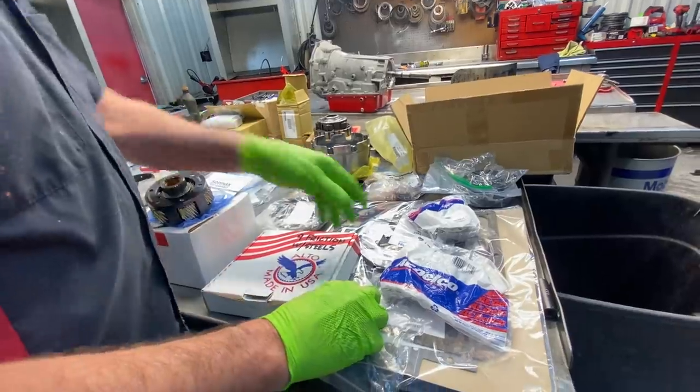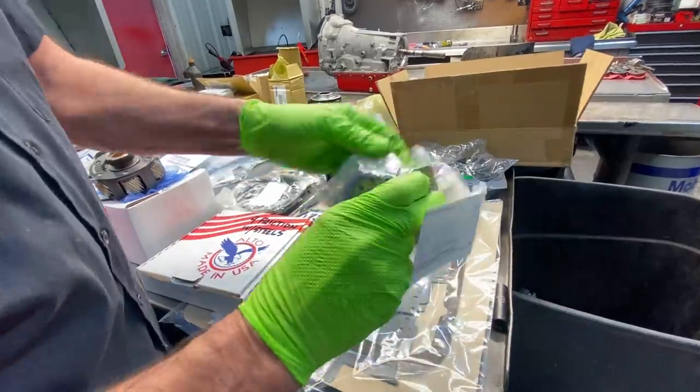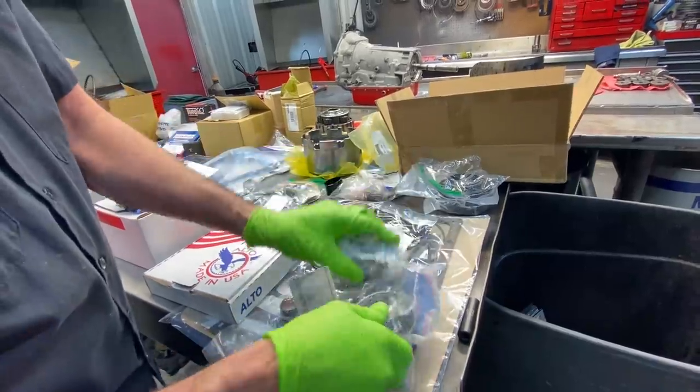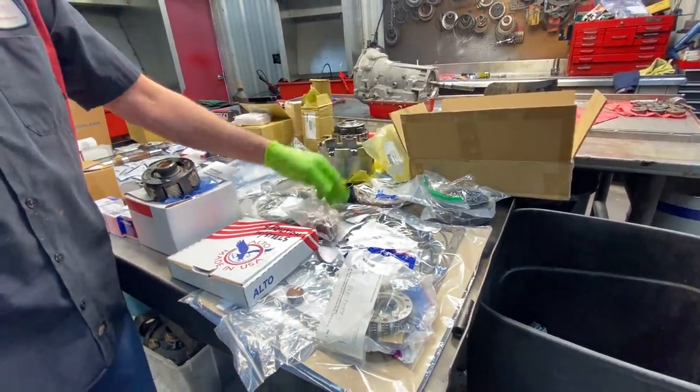We've got our gasket set. We've got our AC Delco springs, cage springs, because when you go to the new Sonnax drum, you have to have a certain spring assembly. So, but he's got two of them. So we've got our bonded pistons, our pressure control solenoid.